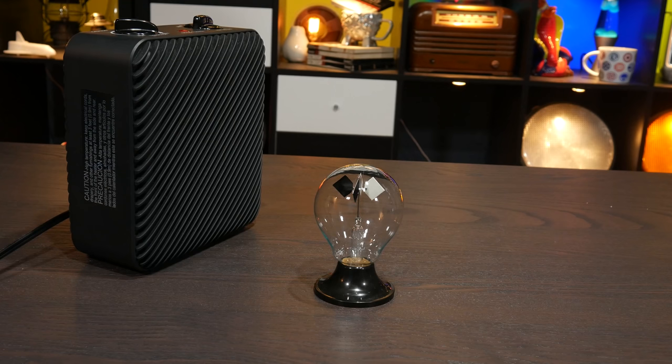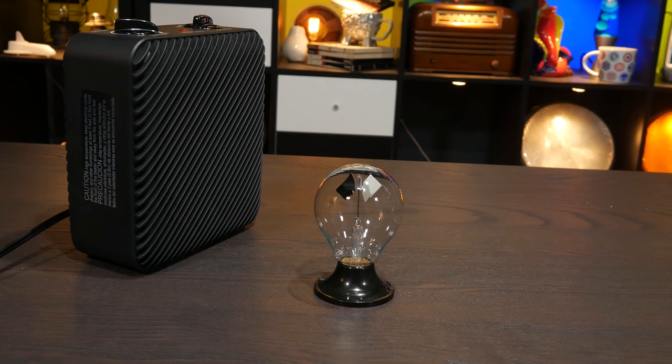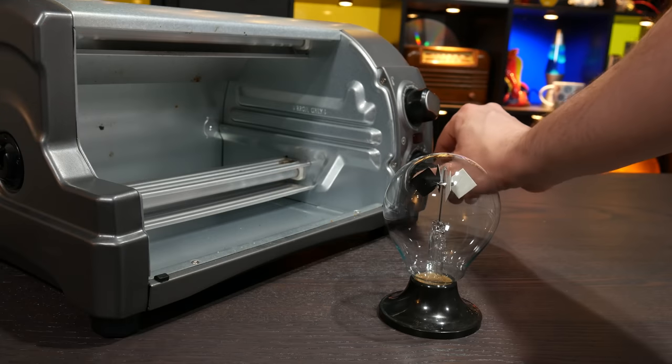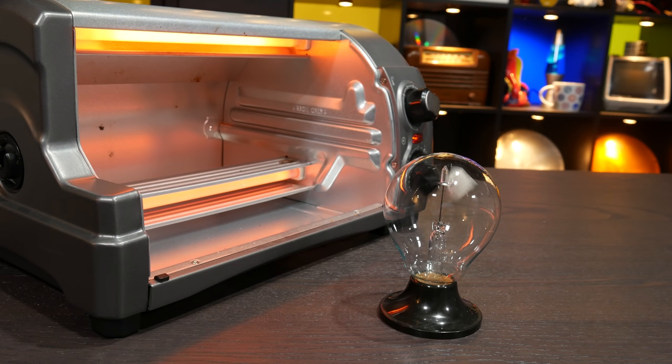Take a look — here's an ordinary space heater. This one isn't meant to be a source of radiant heat; instead it heats the air by blowing it over hot wires. But these wires don't get hot enough to produce much medium and shortwave infrared radiation, so while the radiometer does move, it's not a whole lot. Now take a look at what it does in front of this toaster oven. The heating elements here are quartz heat lamps, and these eventually start to incandesce intensely — so hot they're comfortably into the orange, almost yellow — meaning they're also throwing out tons of shortwave infrared. And indeed, the radiometer agrees.